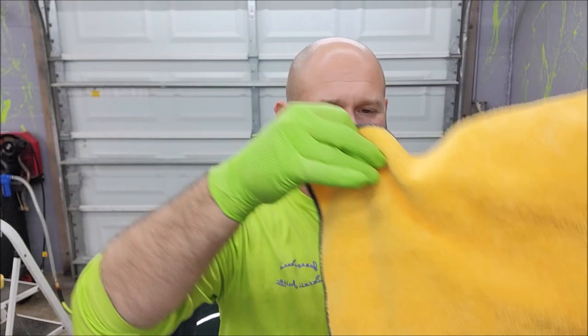It also seems like most applicators, like microfiber, I don't have one around, but here's a towel. Microfiber has a nap, and sometimes there's a thin nap and a more aggressive nap. This towel happens to have about a medium nap on both sides. But my point is, those fibers, when they wipe across the panel, some of them are more full of the Versacoat, some less full. And when you wipe that applicator across the surface, it leaves indention lines, and I can't figure out an applicator that doesn't leave those lines.